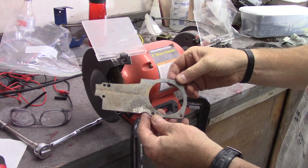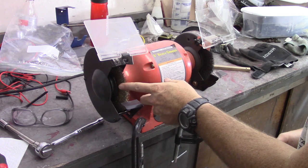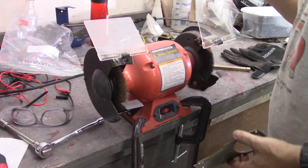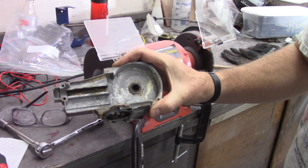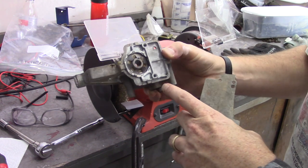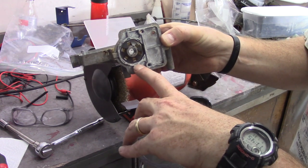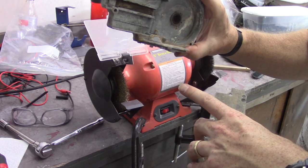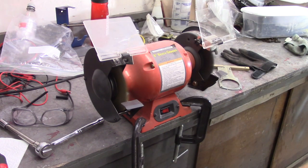There's a little bit of aluminum corrosion - that white chalky, almost yellowish stuff. I've got my bench grinder here with a brass wheel, which is nice and soft so the aluminum won't get scored up. I'm going to lightly go around and clean all this stuff. There's a lot of residual grease in there, so I'm going to use some degreaser. There's also a spring spider thing in there I don't want to mess with - it looks like once that comes out it's not going back in. Safety glasses and gloves of course.